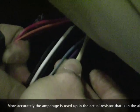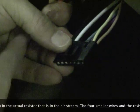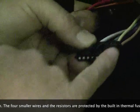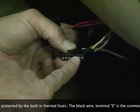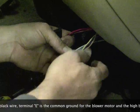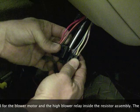The original 4 wires carry very little current. They hardly ever burn. When they burn, it's always caused by flashover from the other 3 terminals overheating. And if you have ones that look perfectly good and test perfectly good with the drag test, there's no point in replacing them if you have the skill and the tools to do it properly. Now we're down to we only have to splice 3 wires, and that'll make for a lot neater repair.